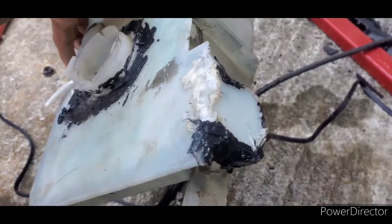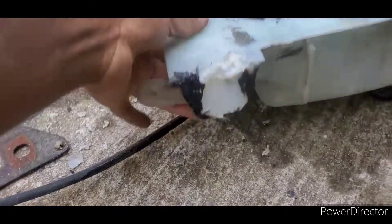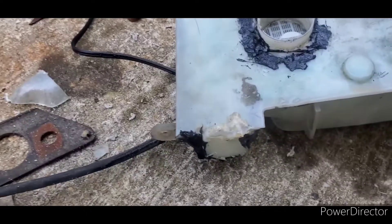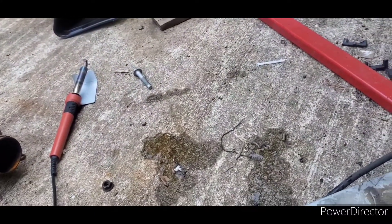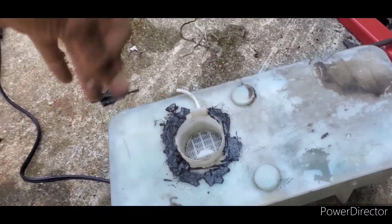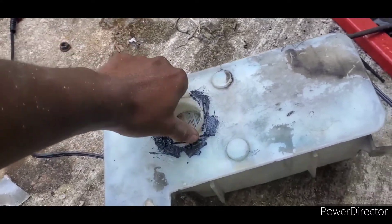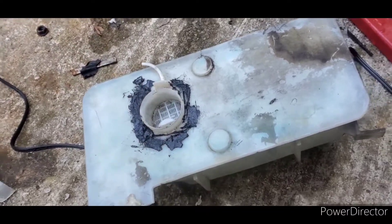Here's my windshield washer fluid — I did the same thing. I cut off this end, blocked it, originally went through the firewall and inner fender, then just cut it and plastic welded it up. It's gonna be hitting the inner wheel well of the fender so you really won't see it. I'll probably have to use some type of pump to fill the fluid, but it's still working.